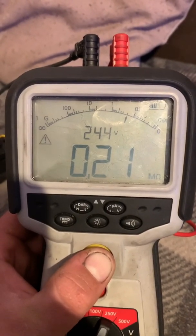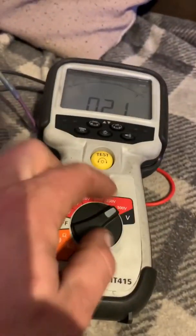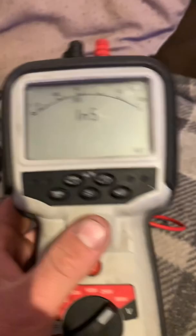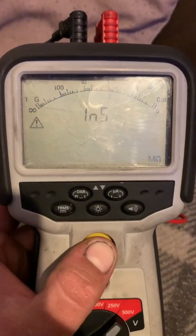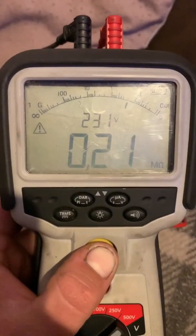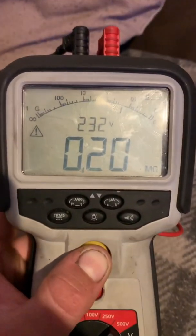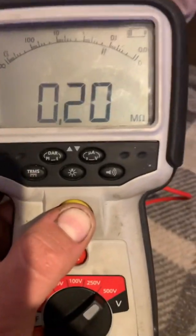Let's turn it to 250. It's not quite going there - it's 245. I've had a bit of a splatter. At 500 volts, not making a noise like I've heard someone make on the car. Like I say, it's a new injector, I'm assuming these are good values - who knows.